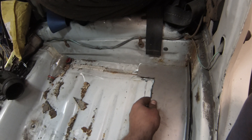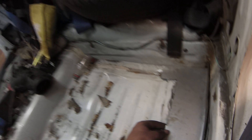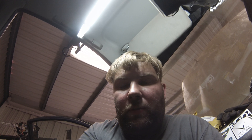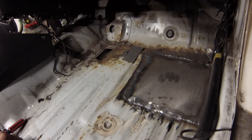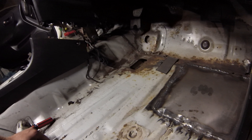Alright so I've cut all the rust out. What I've done is made some plates to go over that — that should cover it quite nicely. I just want to tack it onto that edge. Get it tacked in place. There's another one at the back over there, and that corner, and then the one I cut pretty much square to fill the big hole that was there. There's another little one just to the left of it. We'll get these tacked in and hopefully we can get them stitched up tonight. Then that's pretty much the rust job done. Then I just need to tidy up the rest of the rust patches down there.